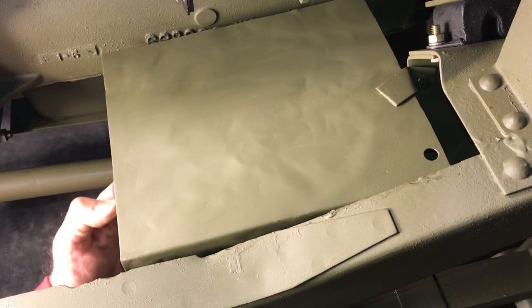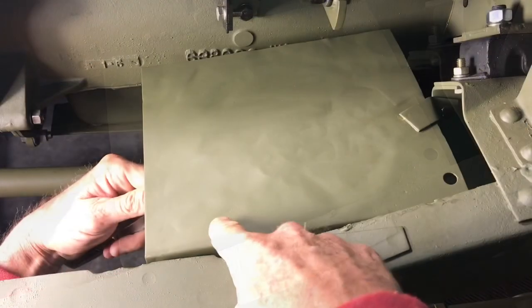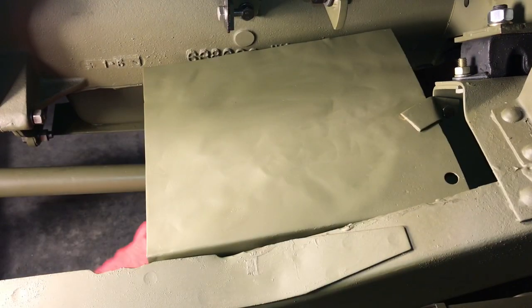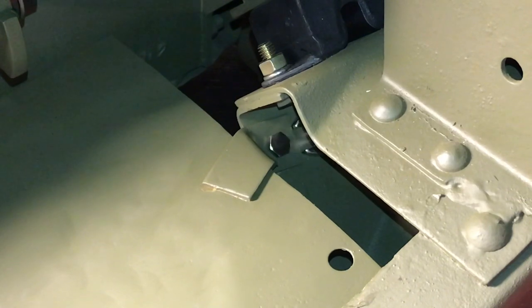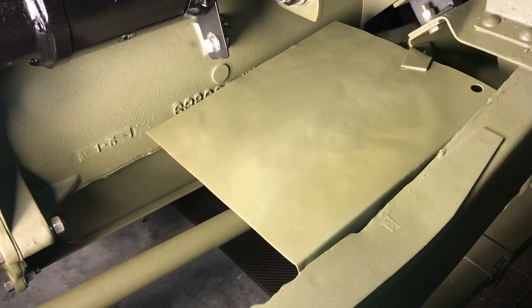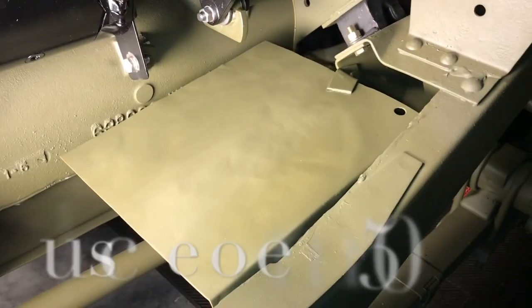Reaching underneath, I'll use a 7/16 inch socket and ratchet to tighten the two bolts to the frame — tightening the back one first to pull it square to the frame, then moving to the front bolt and tightening it. The last step is to reach through the engine bracket from the front, get on that bolt, and tighten the nut from the bottom with a socket and ratchet. The function of the air cleaner splash shield is simply to keep debris from being slung up into the air cleaner, as well as the electronic components. Thank you for watching.